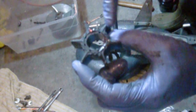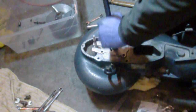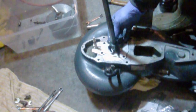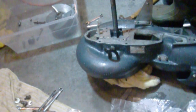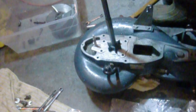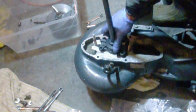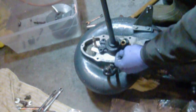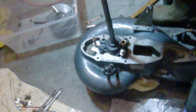You're going to want the notch for the key facing down. My flat spot for the notch is right straight down. Slide the impeller right down, take the key, and slide the key under the notch. When putting the water pump housing on, give enough room to be able to spin it in the direction it's going to go. Once it's seated nice and flat, take your brand new bolts, hand tighten them, and then come back with a socket wrench and tighten them down.